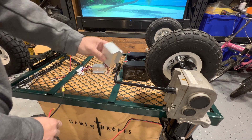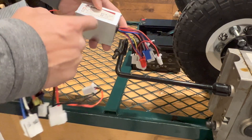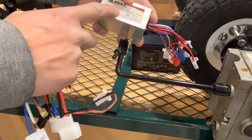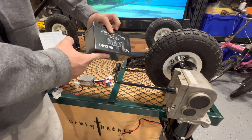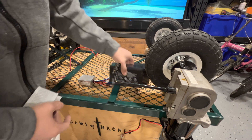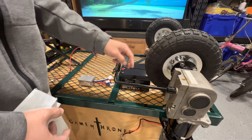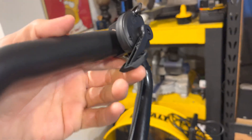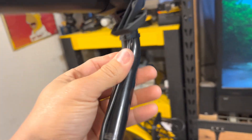To wire up the harness we're going to need two of these speed controllers — these are 250 watt, 24 volts. So we're going to be using two of these 12-volt batteries. Right now we're just going to use one on each side to test, but we're going to be using two batteries per motor.